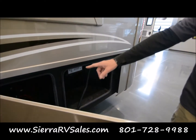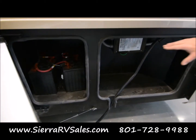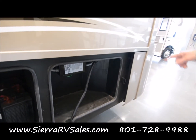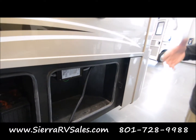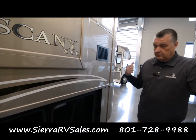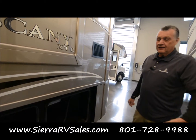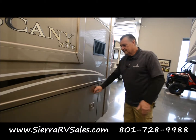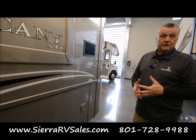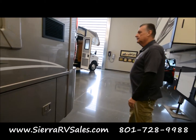Again, this is some storage. You have your house batteries here. This is your shore cable — it's a 50-amp cable and it just rolls back in here when you unplug. One thing to be sure of: whenever you've plugged into your shore cable, make sure that you've unplugged it and rolled it up before you take off. A lot of people either damage their coach, pull off the pedestal, or leave their cord behind. So make sure that cord is rolled up when you do your walk-through around the motorhome.